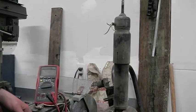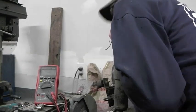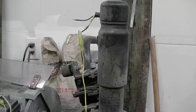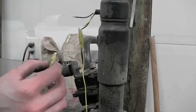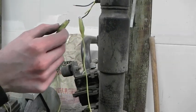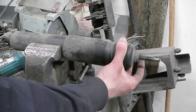Something in here has switched. Let's see if it's any easier or harder to push. Oh, Jesus. Yeah, so clearly that's sport mode. I push this down, you can see it's coming up real slow because it's on hard. If I flick it over to soft, it goes up more quickly. Hard. Soft. Hard. Soft. So whatever's making this thing work seems to be in this end cap here.